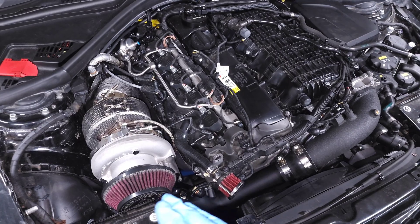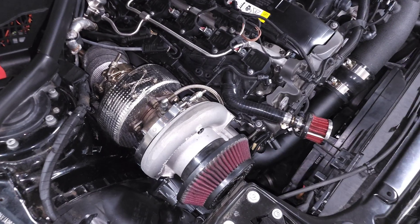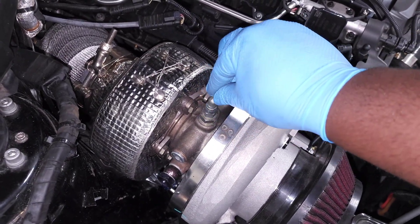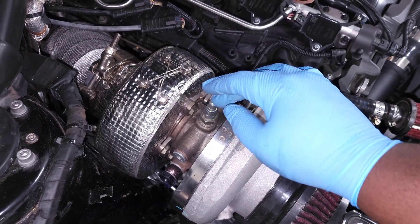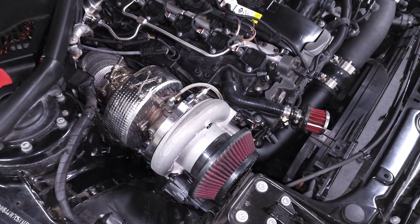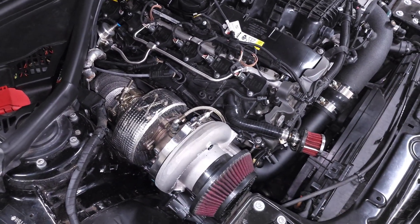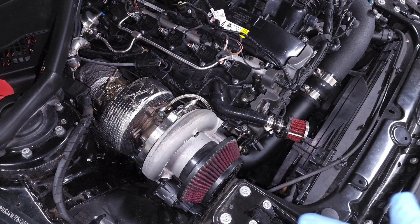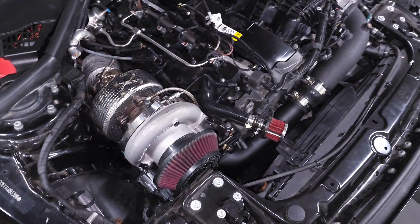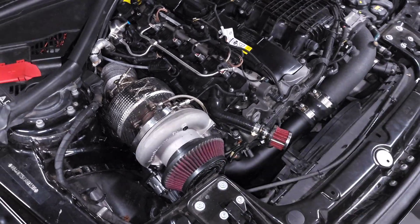The first thing you can do if you have a top mount like me is to physically squirt some oil into the center housing. This is really accessible — I can just unscrew the oil feed on top and use a syringe or something to squirt some oil directly into the center housing. That's a really good way to make sure there's oil in there. I typically don't do that, and especially for people with bottom mounts it's going to be a lot harder to access, so it's not required, but if you have a top mount it can give you a little extra peace of mind.